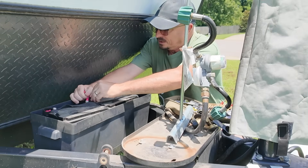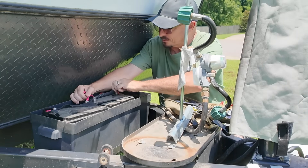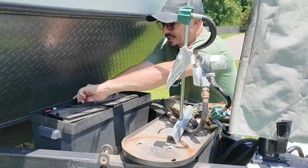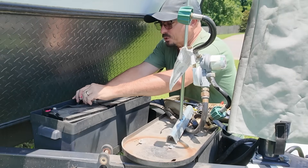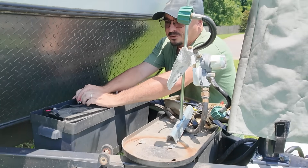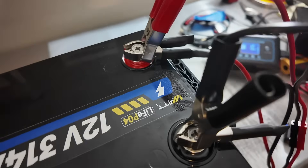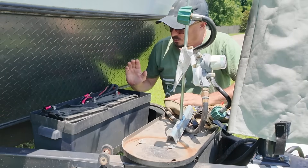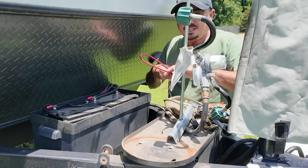Hopefully all of this is not going to be in vain and that 314 amp hour battery is going to fit. I did do some playing with that battery — it took forever to get it charged. It only had like 38% battery in it and I only have 20 amp chargers for those batteries. You take 300 amps and divide by 20 — yeah, it takes a little while. What I did was take both of those 20 amp chargers and stack them together so I was getting 40 amps at a time. Still took several hours but that cut the charge time down roughly by half. So I'm going to go ahead and pull these two batteries out and see if we can get that one 300 amp hour battery in here.